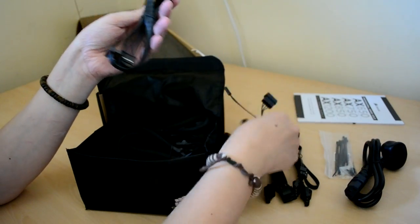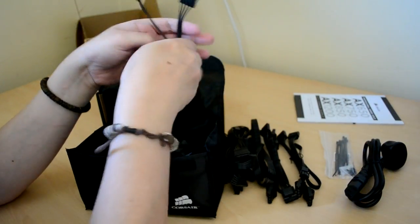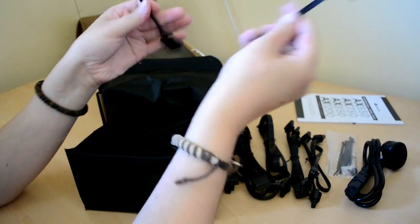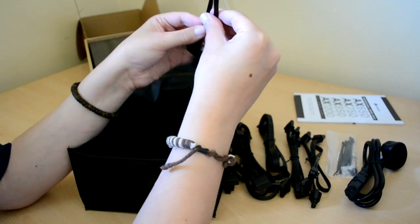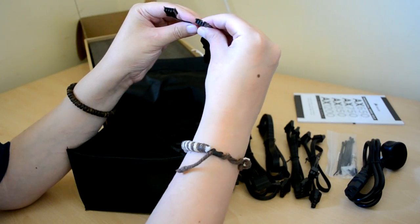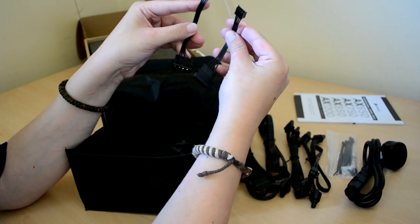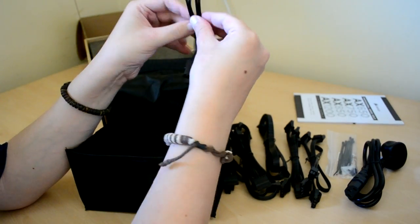And that's another SATA, so that's four sets of SATA leads. Four sets of SATA, two sets of Molex, and two floppy connectors. Most people won't use a floppy nowadays, but these are used for things like powering sound cards — I'll be using one of these to power my sound card.